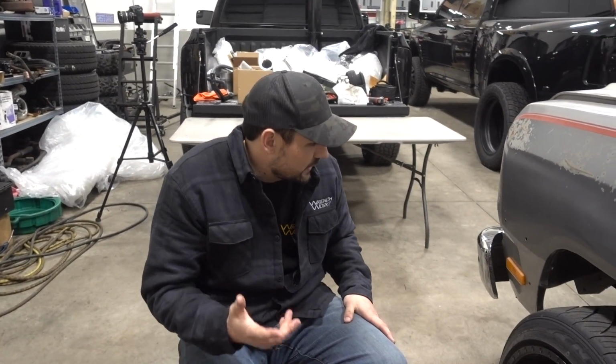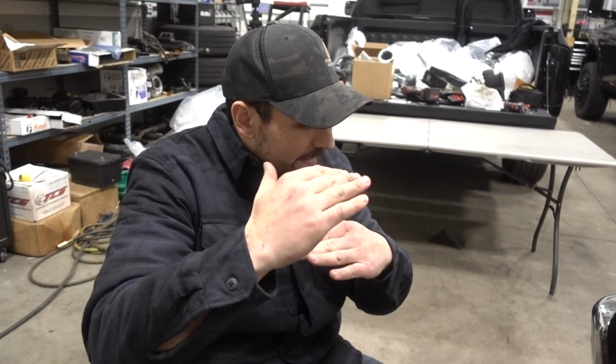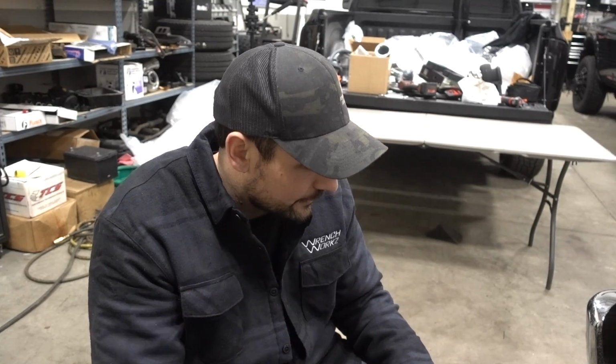Front suspension, if we're talking about drivetrain, the front is actually lifted up. Because this truck was a factory two-wheel drive truck, this may look low in the front, but it actually has Moog part number 7226S springs, which actually give it about an inch and a half height raise in the front, if I said that correctly. I don't know if I did.